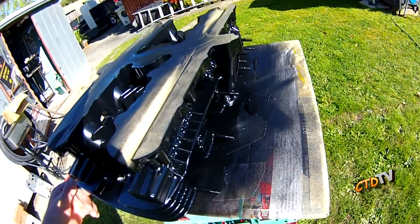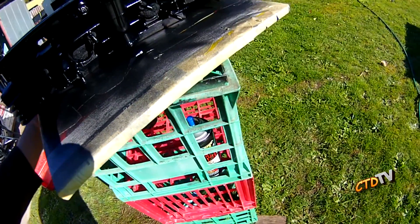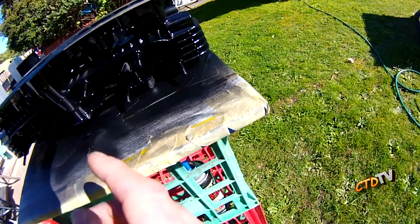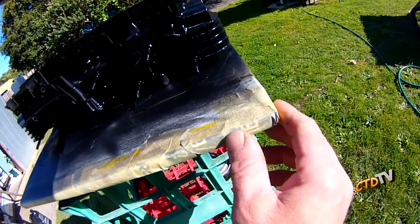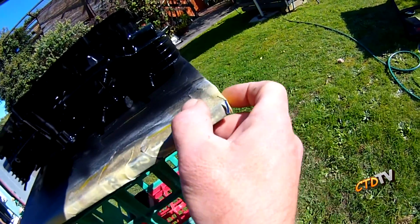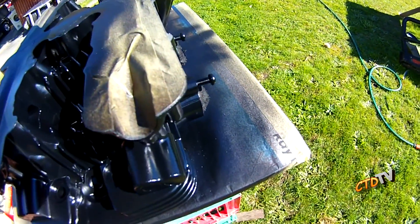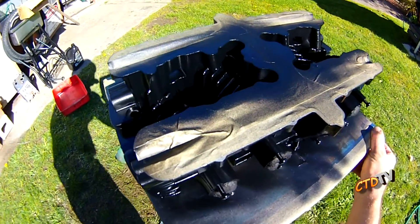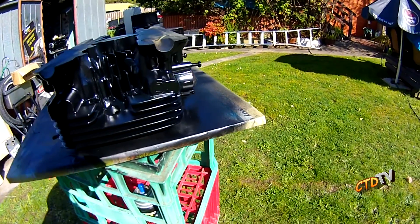Painting time. Well, painted time. I've yet to do a last coat. You have to look around every nook and every cranny, every corner, to get a different angle — otherwise you'll have a thin spot. I think I've got it all covered. I'm going to have to get into some spots with a paintbrush. I'll give it a bit more flash off time, then I'll do the last coat.